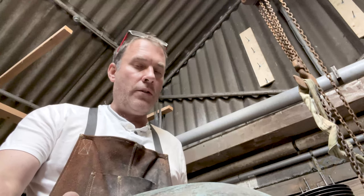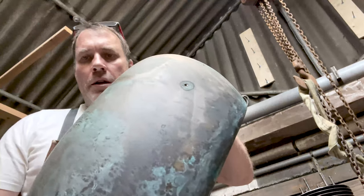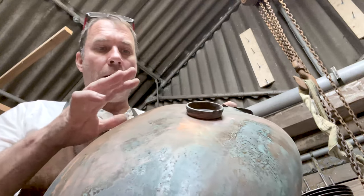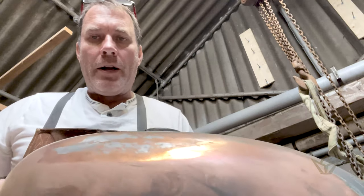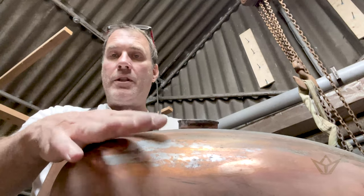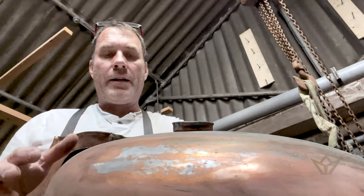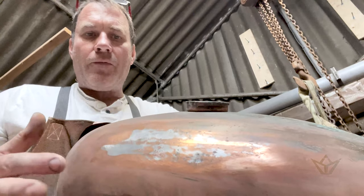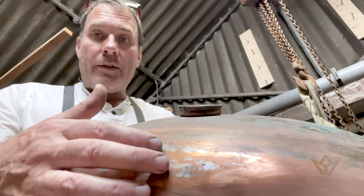Here's the latest update on the tank - unfortunately it's still not chromed. There is a very important reason for that: it failed. It failed with the chroming, not everywhere but on one particular area, and I just want to share this with you in case you get this done, to try and avoid the issue. Guy, who did the dents, is amazing - he is so attentive to this project and so determined to get this tank chromed perfectly. He lead filled it the old school way thinking that would be okay, but he sent it to the chromer and the chrome wouldn't take.